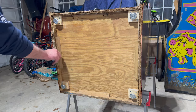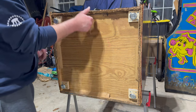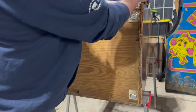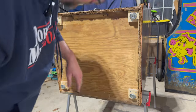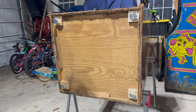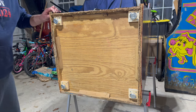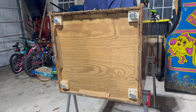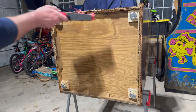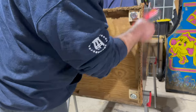Looking at this again, it's actually not that bad. Obviously we've got some blown out stuff here and some material missing here — it's actually the worst sort of in the front. I want to knock out the loose stuff as much as I can, and then we will bring in wood hardener and squeeze this back in with clamps. Yeah, it's really not that bad except for here.